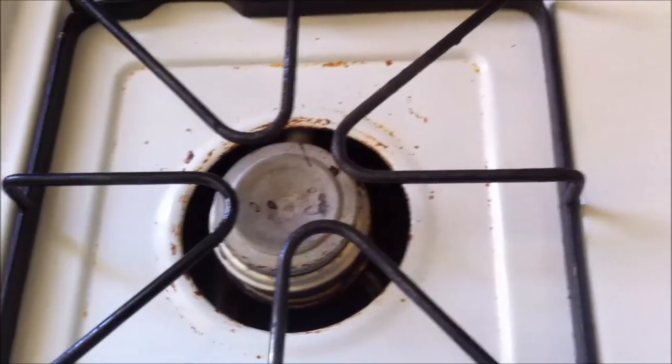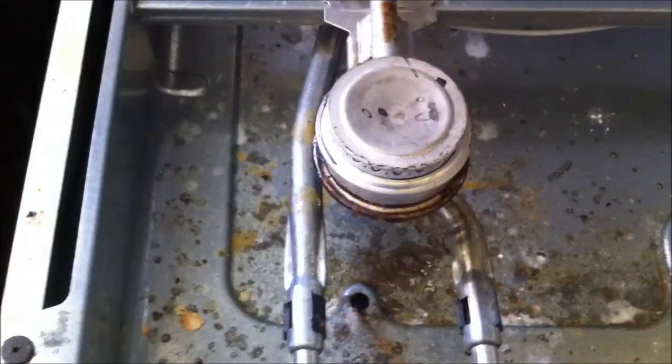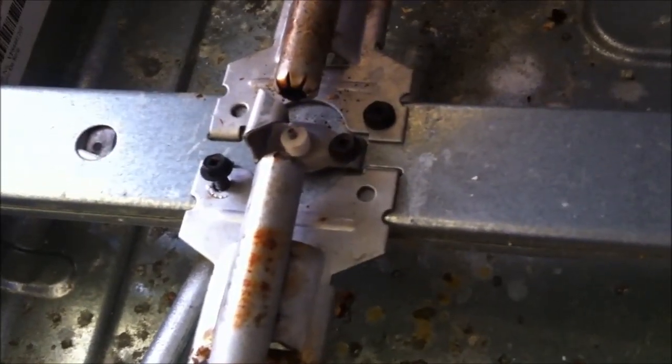So what do you do? It boiled over. Please excuse my oven — it's an older oven. Because when you lift the top up, that's what it looks like underneath. You got your burners. You got the igniter in the center. See that little spark? They both spark at the same time — one over there sparks too. But there's no gas going to those ones, that's why they're not lighting.